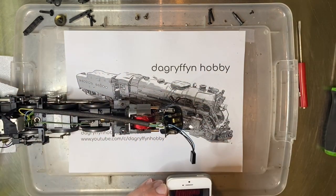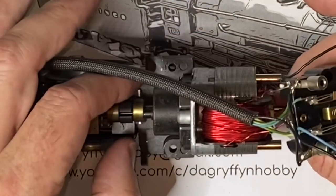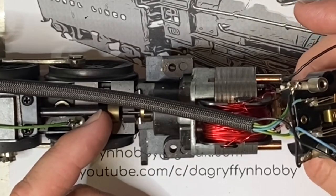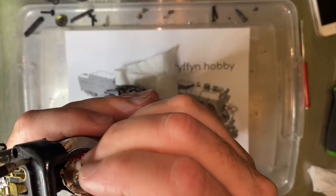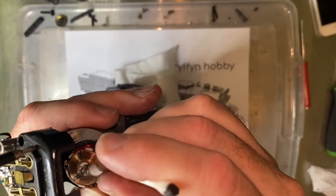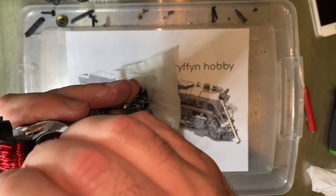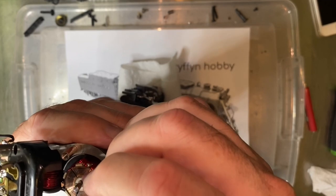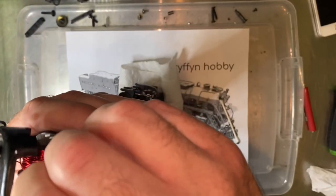Okay, brushes are out. The commutator face is definitely a little dirty and scratched up. Hopefully a good cleaning will help. That is an interesting coupling — it's a rubber grommet in between the two. I'm sure that would make a pretty crazy noise if that bushing was gone or deteriorated, so that's definitely something to check. You want to make sure not to leave any fibers in here and make sure that you don't remove that washer. Make sure there's not too much carbon built up in these grooves. Clean it up. Sand down the brushes a little bit — hopefully make them a little smoother.